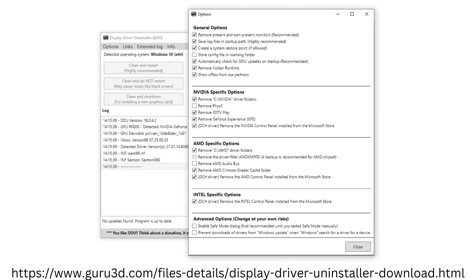Run DDU to clear out old drivers. Get back into Windows by reinstalling a good card or switching your computer to its integrated GPU if it has one. Once there, download DDU, the display driver uninstaller. Run the program and it will remove every trace of your old card's drivers. This is also a good fix for when the new card physically works but is only detected as a generic GPU in Windows. Once you have scrubbed the old driver from the system, reinstall the problematic GPU and install a fresh copy of the latest driver from the manufacturer's website.